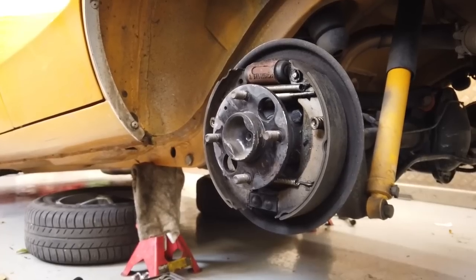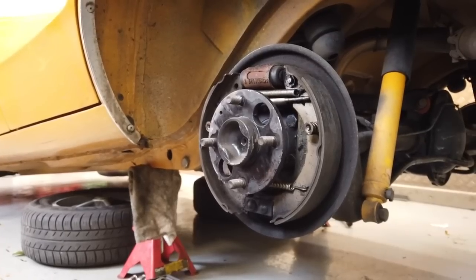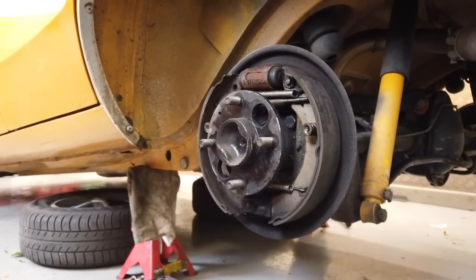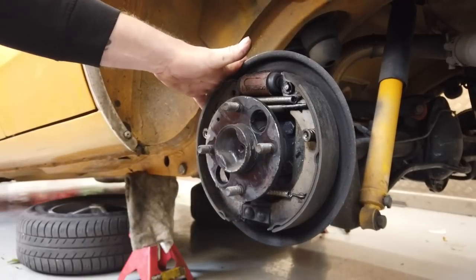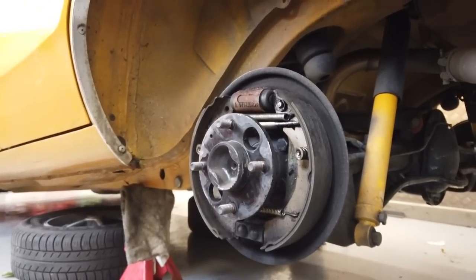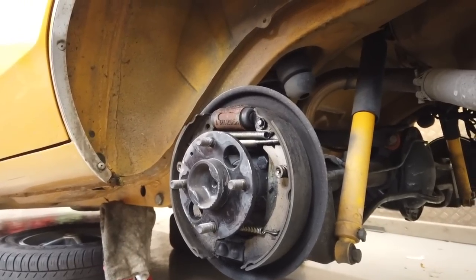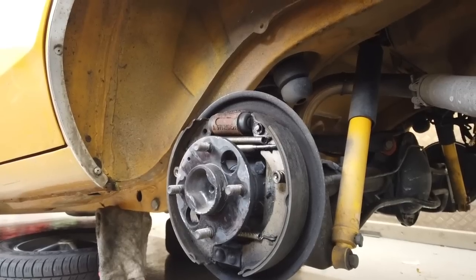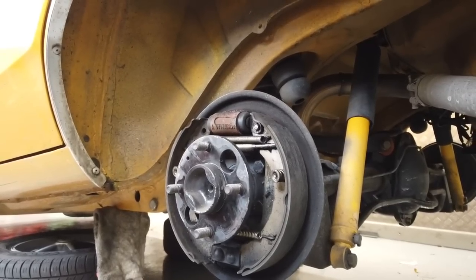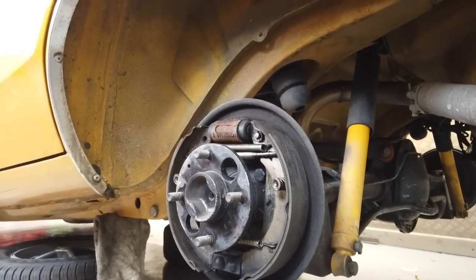Catch you in a sec for axle replacement, and later on when I get back, fuel sender replacement. Stop that. We could smell fuel as soon as we came into the workshop this morning. I must admit, I've not smelt it before, so it's a new fault. We've also got a leaking speed sensor on the gearbox leaking as well. That needs some RTV on it. Probably the gasket, the rubber O-ring seals, probably letting oil go past it.